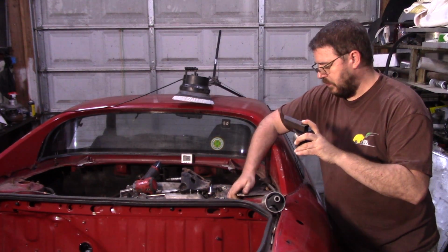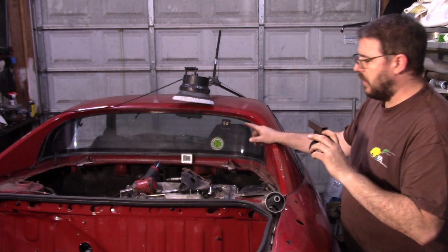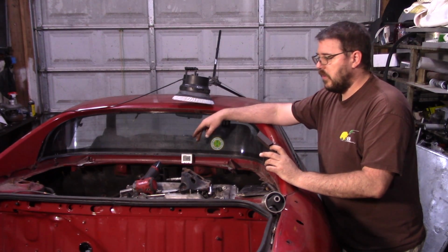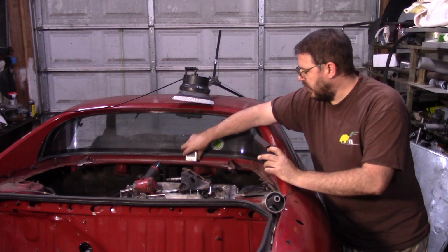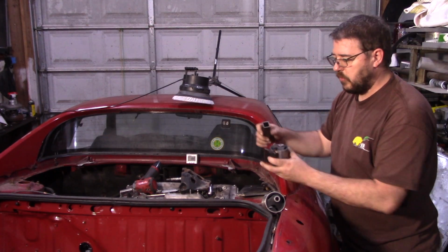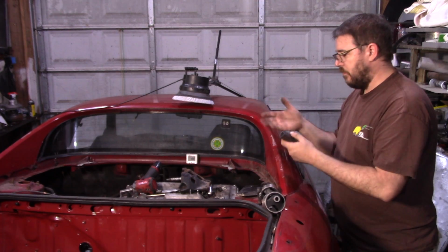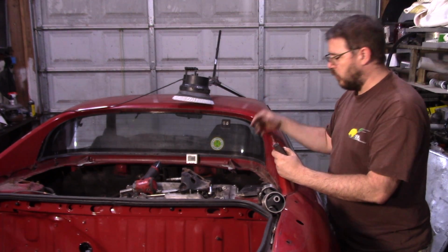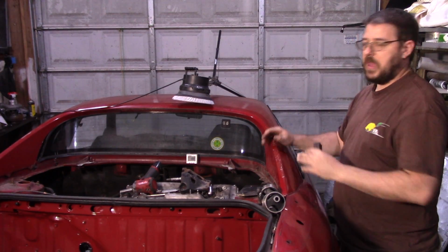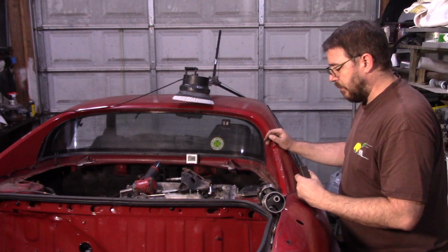But importantly, I'm not going to weld between here, because then this whole thing is intentionally going to be low, and then I'll use the angle gauge here to set the angle just right in the engine so that this thing sits right with the load on the bushing. And then those shims, I'll just use metal shims. I'll bring the welder in, zip zap, and then I'll have in 3D space where everything needs to be relative to each other. So let's get to that.